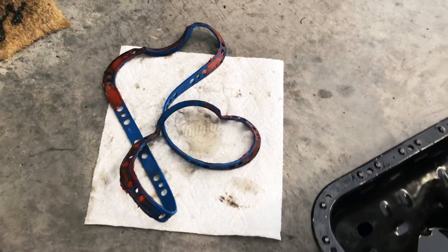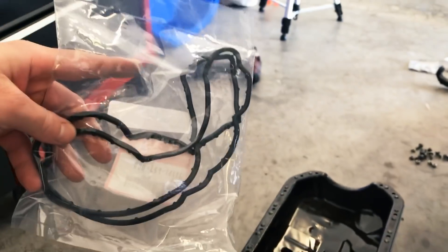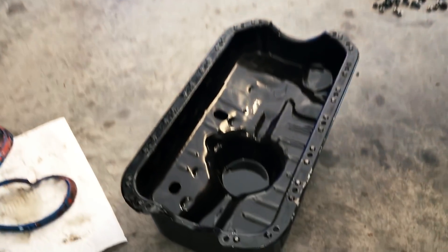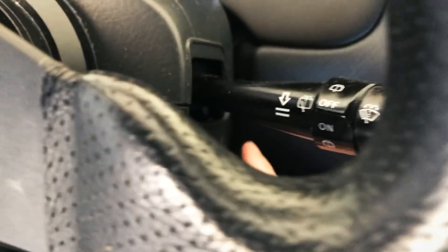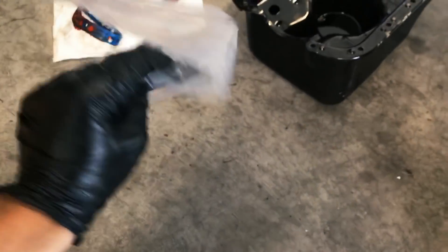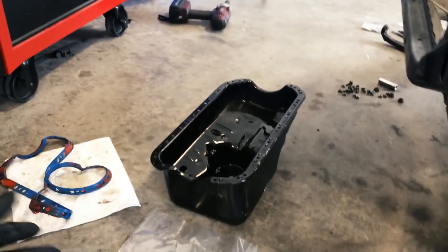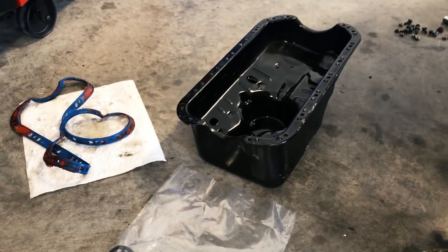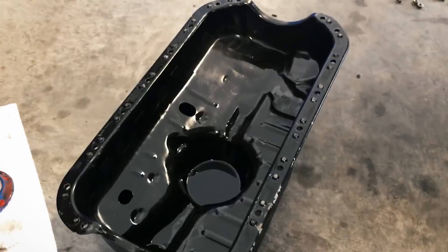I don't know that we did it quite right the first time. So I'm probably going to have to go exchange this at Honda and get the right one. And I'm back — now that's more like it. This is the guy. The Honda parts guy said likely these people changed out this pan because all the black pans are steel pans, and that's going to come with this gasket that was likely off an LX with the D16Y8. This is the right gasket — nice and flat surface matching up.